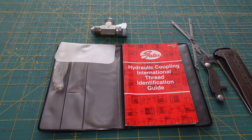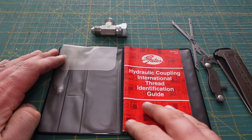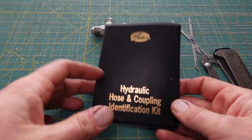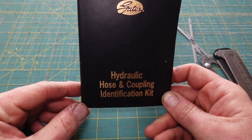I'll put the CAT part number. The CAT one is kind of expensive — it's almost $400. So if you work at a CAT dealer or have a good account there and can charge stuff out, I would maybe get the CAT one. Otherwise there's the Aeroquip version, or you can just search eBay for 'hydraulic hose coupling identification kit' like I did.